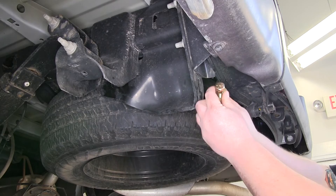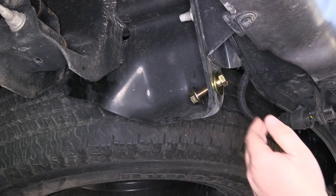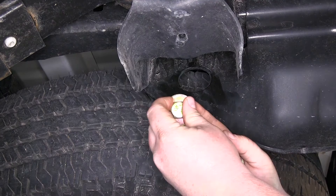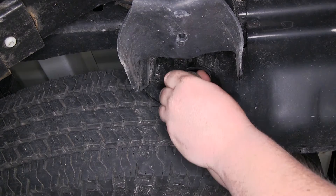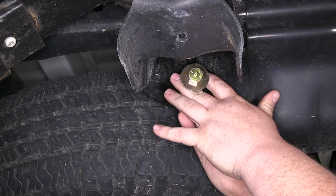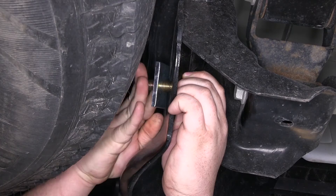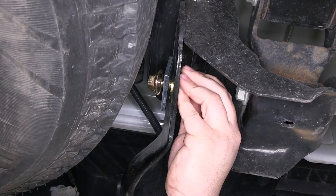For the back attachment point that faces the rear of our vehicle, we'll use one of the hex head bolts and a flat washer that'll go through the hitch and through our frame, then attach with a flange nut on the back. For the location towards the front of our vehicle, it'll get a hex head bolt and a flat washer going through the hitch and through the frame, then two flat washers to take up the gap in the frame. Your hitch will be in between the one washer and the two washers on the bolt, and on the backside it'll get the square block that comes with the kit and a flange nut.